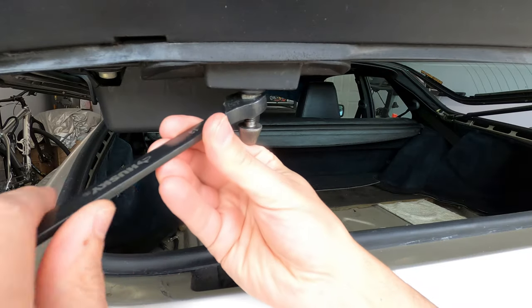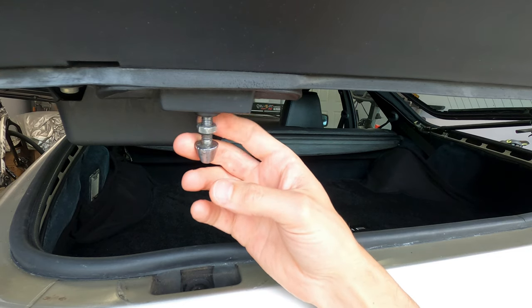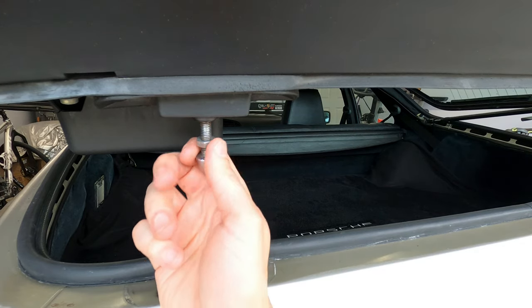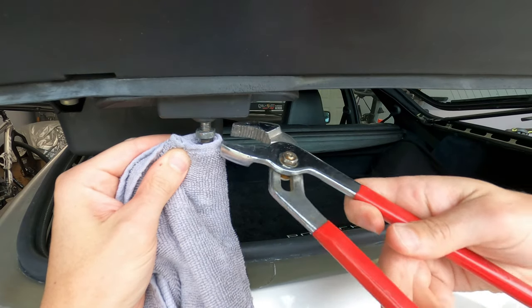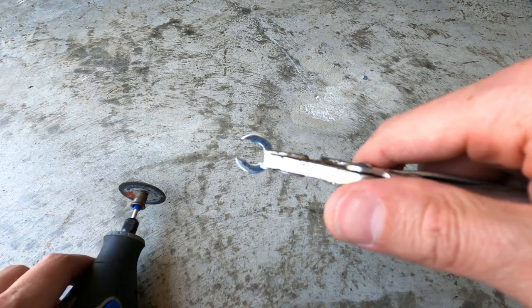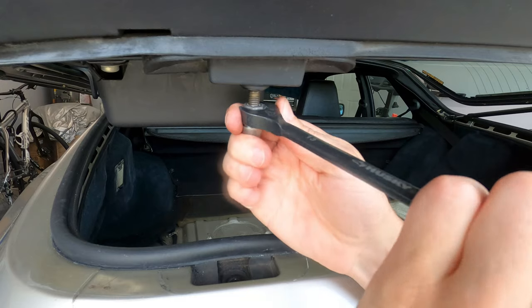To adjust or replace the hatch pins, you'll first need to loosen the 13mm lock nut at the base of the pin, and then the pin can be loosened or tightened accordingly. The pins on the early cars featured a notch in the bottom where a flathead screwdriver can be used for adjustment. The later cars have solid pins, so you'll need to use some pliers or vice grips on the end of the pin. If you'd like to reuse the pins, you may want to wrap the pin in some cloth to reduce any tool damage. Alternatively, if you can track down or fabricate some size M8 C-shaped washers, those can be stacked on the non-threaded section of the pin and the lock nut tightened against them. Then a 13mm wrench can be used to loosen the pin.